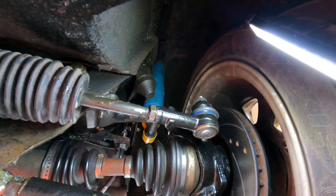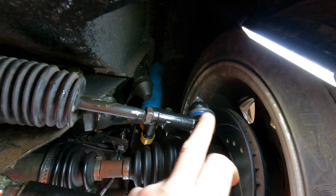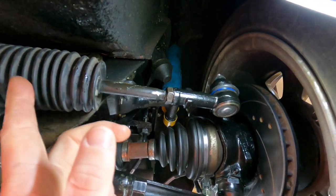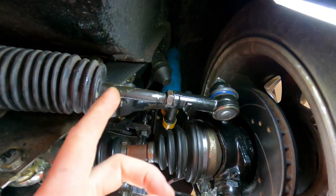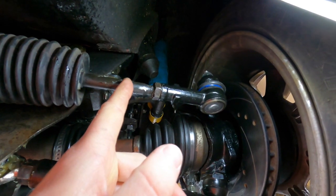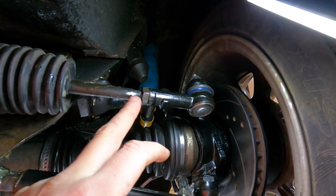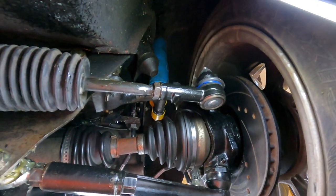There's a possibility I might have to take the weight off the wheel because there's quite a bit of pressure on the system. Also with a new rack, it can be really stiff to turn in the ball at this end. What I've done in the past is weld a half nut onto the rod, which gives something to grip when adjusting. The flats help you count the turns, and there's a bit of paint on it which will help count how far we've turned it.